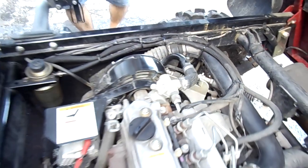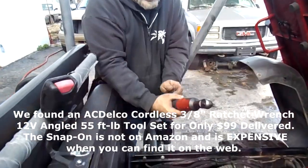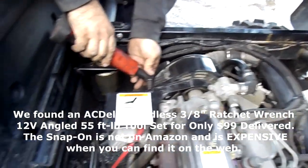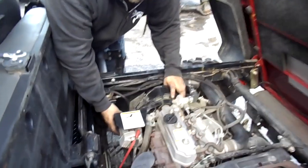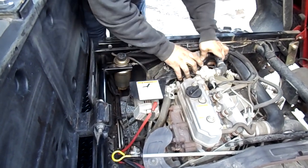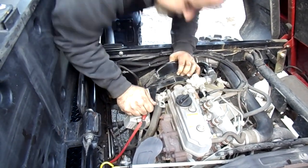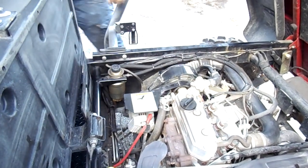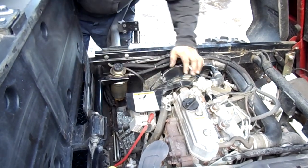Using the snap-on ratchet for the last bolt — these things are torquey. Snap-on hard sockets are great for taking things off, but not for putting them back on. Always hand tighten when reinstalling, especially on motors with aluminum. We're doing this because the fan belt is loose, and if it's loose enough it won't give enough tension to the water pump for proper coolant circulation.